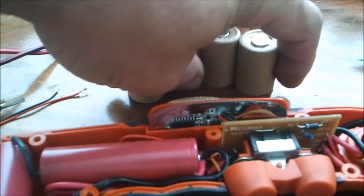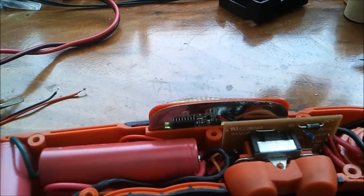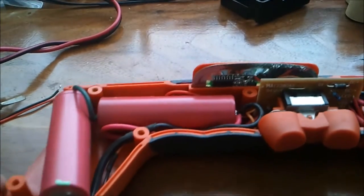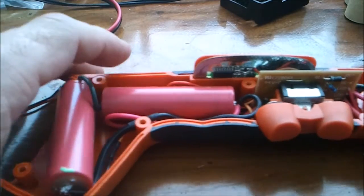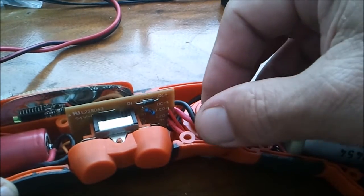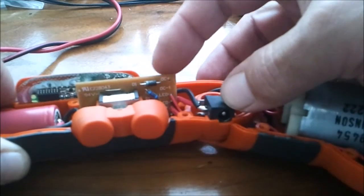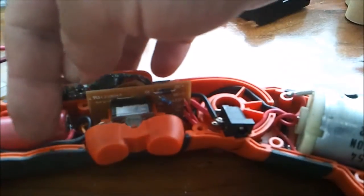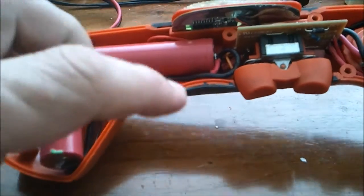I thought my drill was gone, but I decided to experiment with lithium-ion batteries from a laptop, and that worked. So I went ahead and put these in here today. I rewired the power plug — the charge port from right here on this board — around behind here into the positive and the negative, and I've also wired power wires for the drill into here.